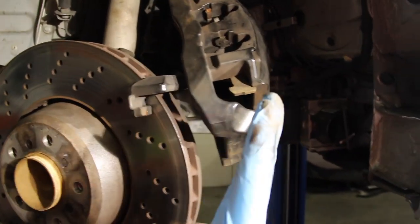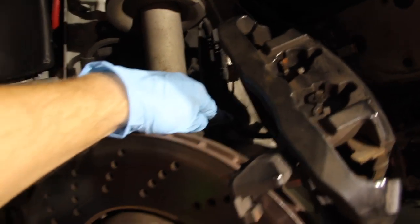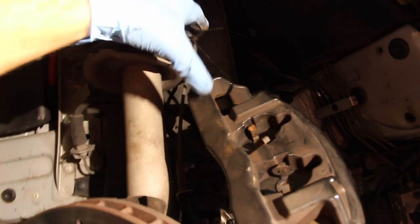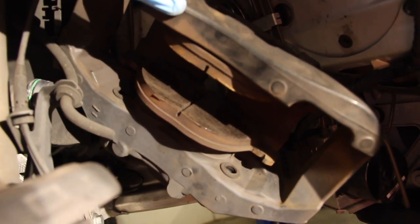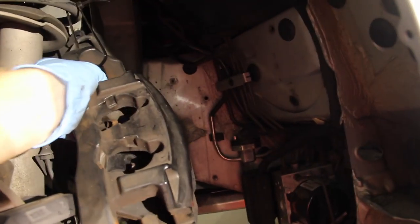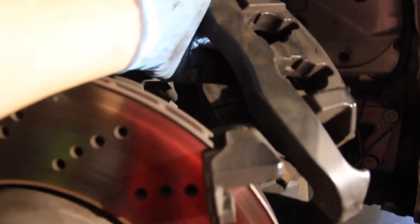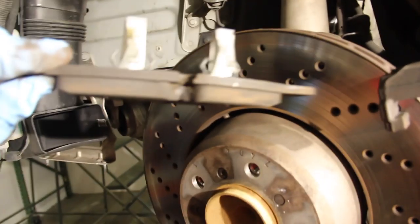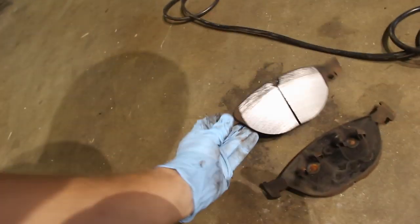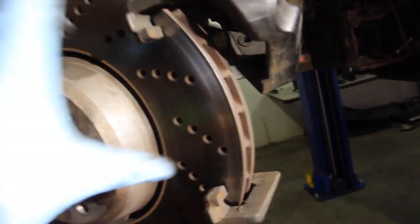Once I took the C-clamp off, the caliper easily slid right off of the rotor. I didn't have a bungee cord handy, so a zip tie works in a pinch - you just want to secure the caliper up kind of out of the way. More importantly, make sure that you're not letting it hang on your brake line. Now you can get a great look at the side of the pads and really see how much pad material is left at 84,000 miles. Just stick a thumb in there and give it a push - the pads should pop right out. The outers and inners are obviously different, and the inner is pressed into the pistons. Now we can go ahead and remove the carrier, since that's in the way and inhibiting the removal of the rotor.